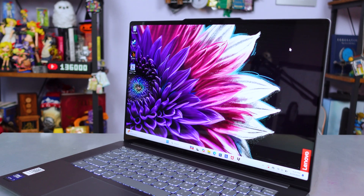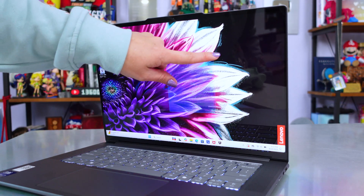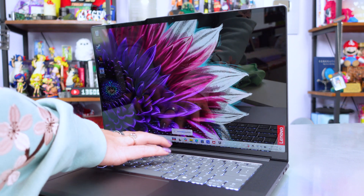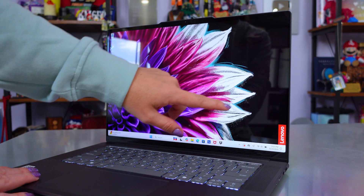The display on this thing is really pretty. It's a 15.3-inch PureSight Pro LCD display, which is Lenovo's design made to deliver exceptional color accuracy and clarity for creators and professionals. Sadly it is not a fancy OLED, but it still looks really great — 2.8K resolution, 120Hz refresh rate, 500 nits of brightness, and it includes Dolby Vision. It's not the brightest laptop I've reviewed and isn't as rich in colors as OLED, but it's very lovely to use. It's also a nice glass touch screen with an anti-fingerprint coating that does a fine job of hiding fingerprints.